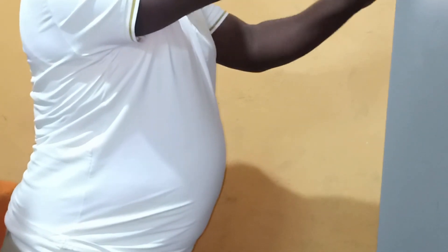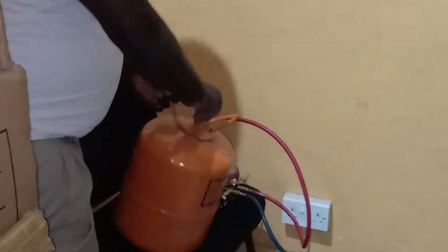We render this fridge uneconomical to repair. Because we cannot deform the design from the factory — we cannot spoil the design from the factory. So this customer must be given another fridge, because we cannot repair inside the foam. Otherwise the foam is very flammable — no brazing can happen inside. So I'll close my gas. I preserve the refrigerant and remove my gauge from the system. You can see how much gas has gone inside.